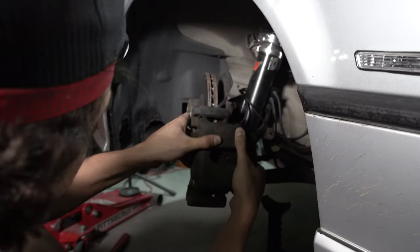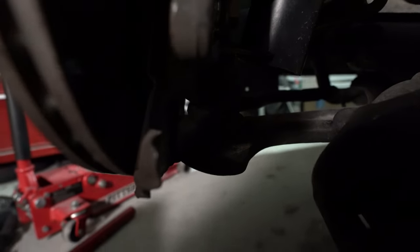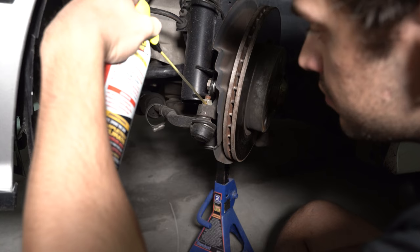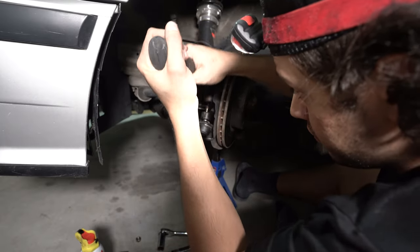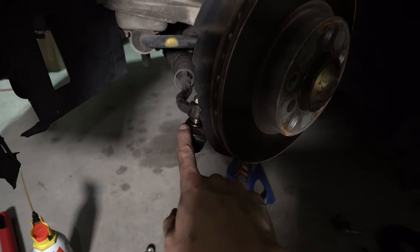This amount of angle that I'm getting - my next step now is removing this here. It's so dark. This right here is a little ball joint. We're gonna have to loosen that nut and then use the pickle fork right there. Removing this does in fact just take you hitting it - I didn't believe it, I really didn't believe it, but it works. Just keep hammering your knuckle.